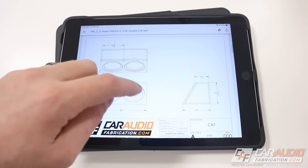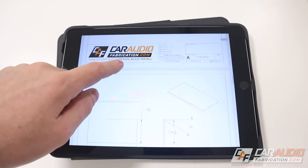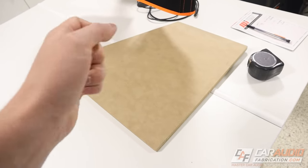I did quite a bit of testing off camera and found that in this trunk, the trunk of these cars is actually sealed really, really well. With the subwoofers firing backwards, which is typically the best orientation, I just wasn't getting as much output as when I was testing with the subwoofers firing forwards. If you want to see the test process I go through, check out the video up in the corner. So by doing that testing, we've decided we're going to face our subwoofers forward into the cabin, which will work out great because in the middle of the seat, there is a fold-down pass-through that gives us access into the trunk. Here is our design blueprint — we have all of our plans ready to go along with all of our dimensions, did our test fit with the mockup panel, so we are good to go. Let's start making our cuts.